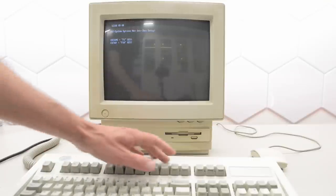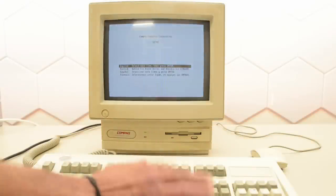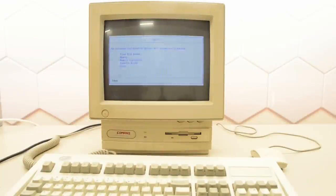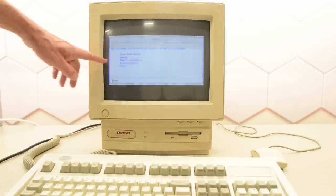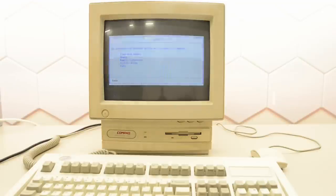Let's try F10 — Compaq Computer Corporation. The CMOS battery has clearly gone bad. We've got an interesting message: the following configuration options were automatically updated. And the interesting bit here is the Math Co. As far as I know these had SX CPUs, so maybe we're lucky — maybe there's an upgrade in this machine.